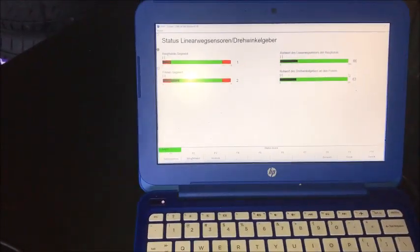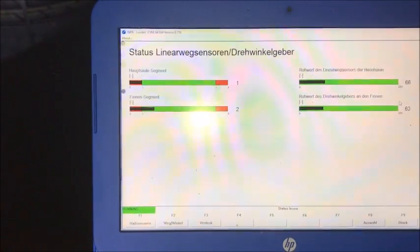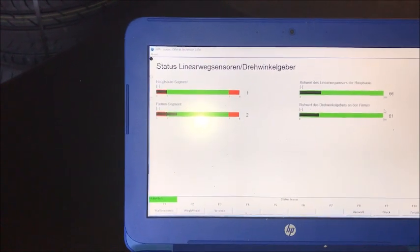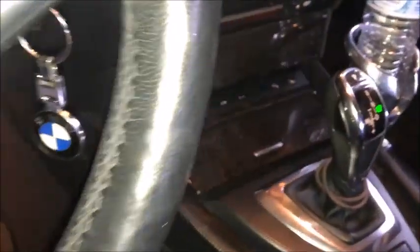When a sensor is out of position, you get the blinking red top-lock light and the display error saying top-lock. Going down the road it goes bong bong bong, sometimes it'll come in. What I'm going to do is go back there and tap the back wing and see if that sensor will drop back in — we'll see which one it is on the screen so we know which one to adjust and which way. After some thumping — bam, it's in position now and we no longer have the blinking red light.